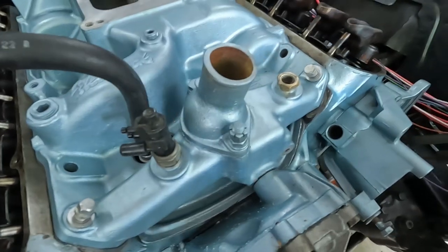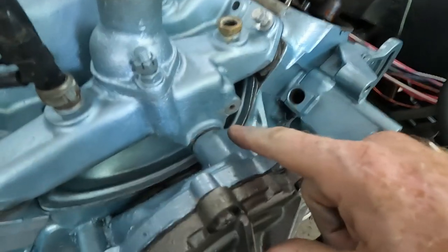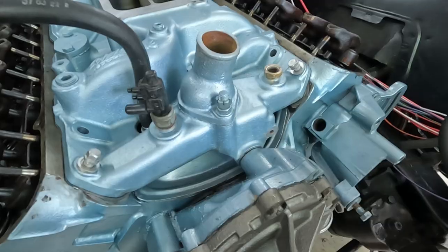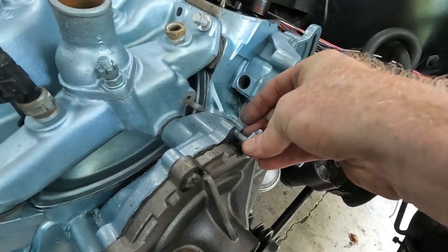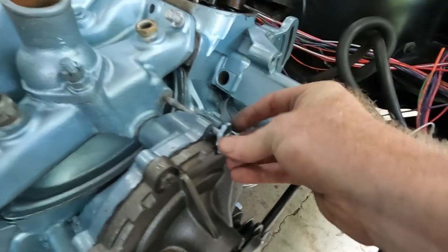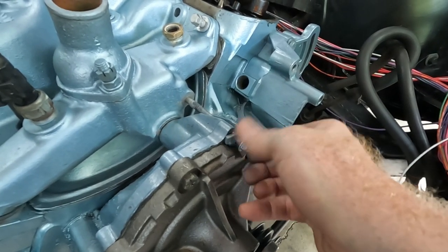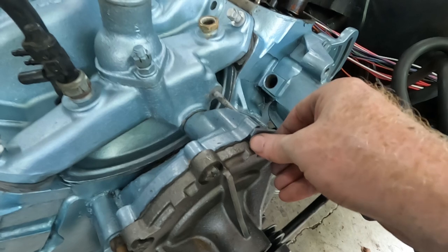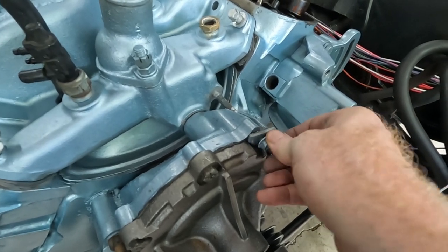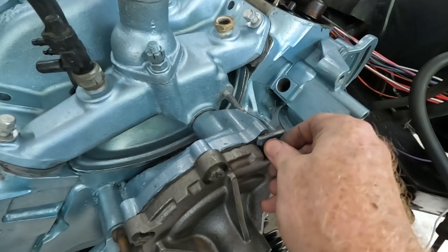Back to the drawing board. I got it in — and this is fitting a little tighter now. The holes are lining up. I've got a bolt here, a bolt back there. Now I'm going to use this to pull it in a little bit more and then I can tighten all the rest of the bolts down. I did make sure I've got anti-seize on this because this is aluminum — you do not want to get that caught in there.